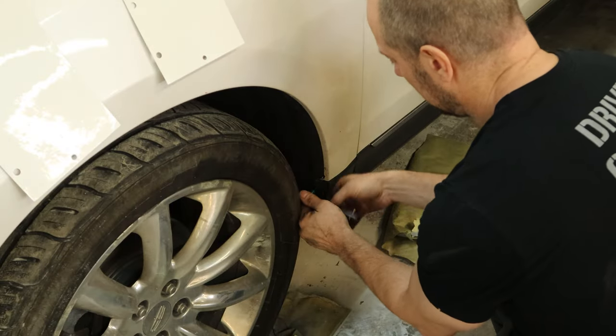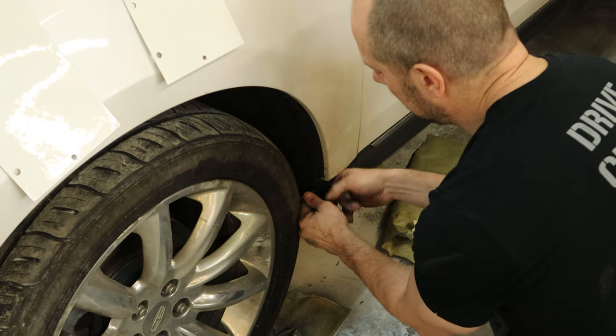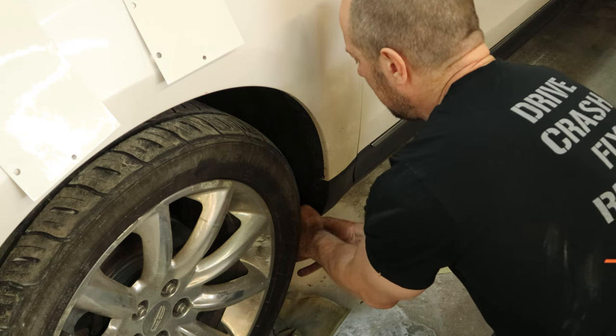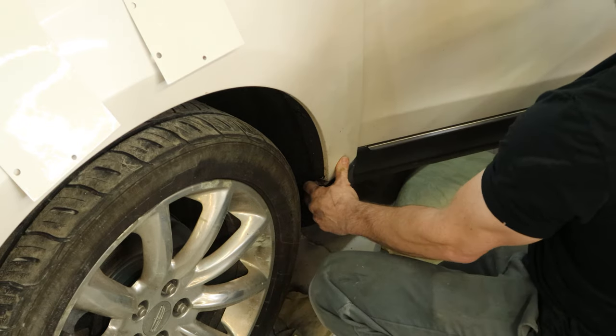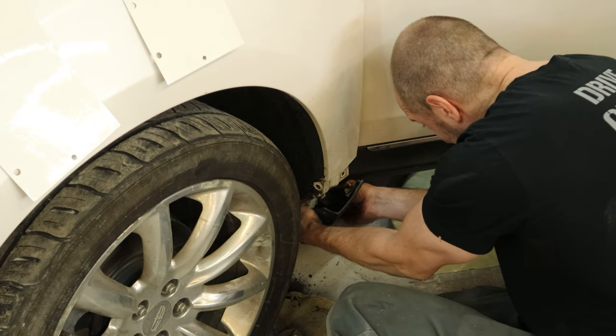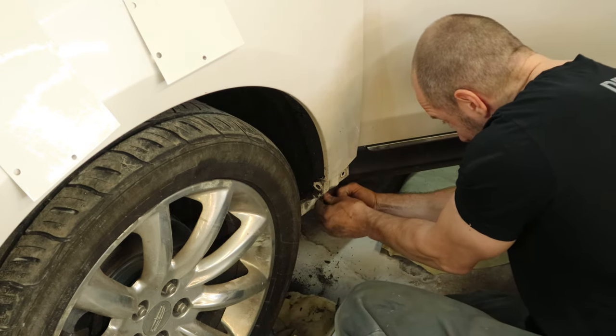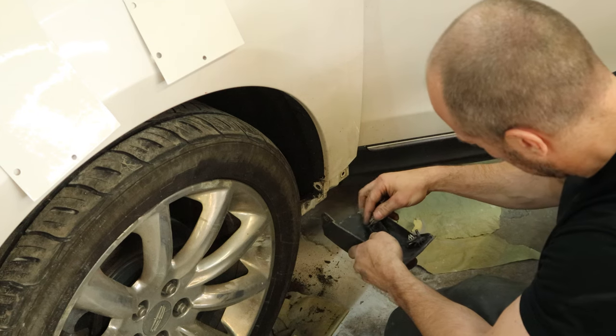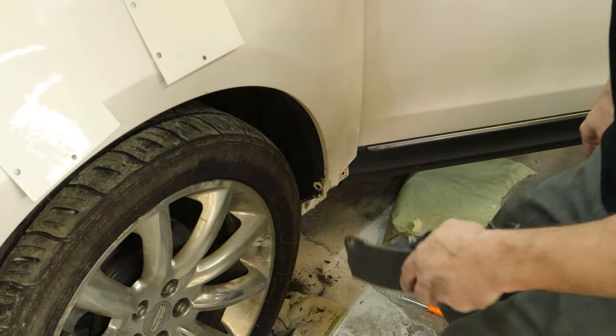Now we're going to strip down the fender on the driver's side and pull the lower molding off the back. You can see the little test panels the painting gnome was using to figure out how many coats of pearl it's going to take. Pop the clips off of our molding and push the molding off the bottom clip, put the clip back in. Then we'll pull the wheel liner forward and clean out the compost bin that's developing behind the fender — which I'm not going to show you because I don't want the clean freaks to think I have joined their cult. So that's as far as we're going to go on our Lincoln for today. It's in the paint room, so as soon as the painting gnome does his job, I can throw it all back together and hopefully get it out on the road. Thanks for watching, and I'll see you soon.